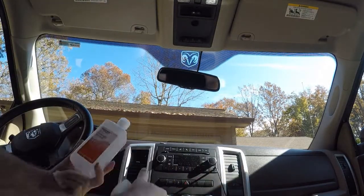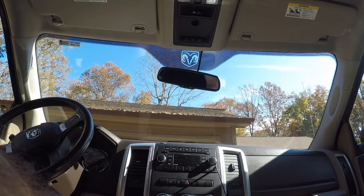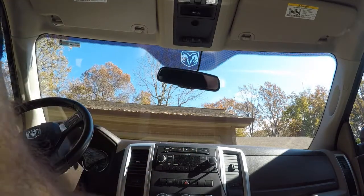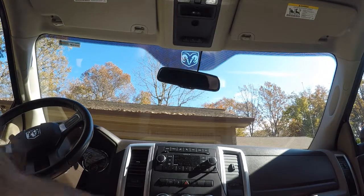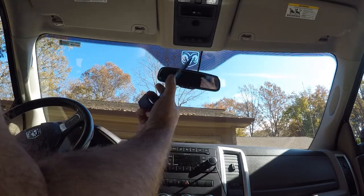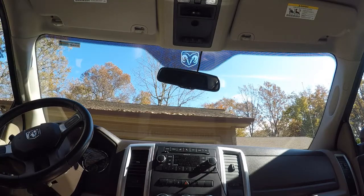Just use some 91% isopropyl alcohol to remove the leftover adhesive. You can probably use a lesser percentage — I think it comes in 70%, maybe 60% or 55%. I just used this because that's what I had. I was cleaning my windshield to get a good surface for the mount to stick to, and ended up removing it about 20 minutes later. Thanks for watching, hope that helps, hope that saves you some hassle with the heat gun. I think you're supposed to let them set up for 72 hours, so I don't know if this will still work once the adhesive mount has fully set — but give it a try. It definitely works for one that's been up for about 10 or 15 minutes.